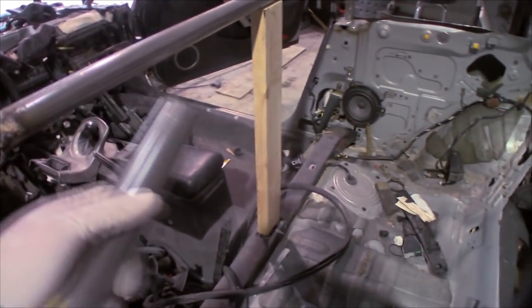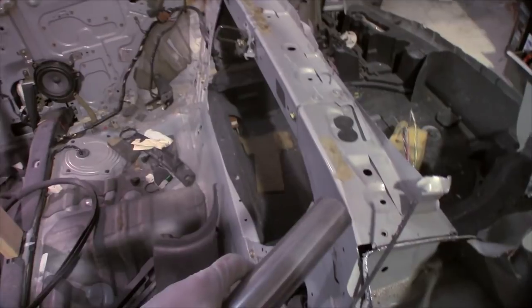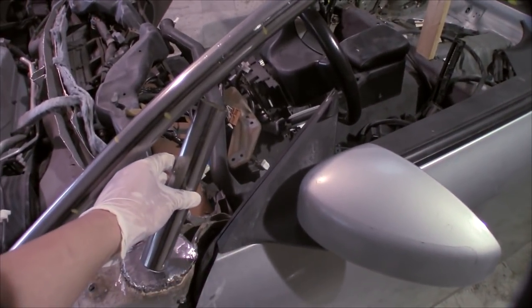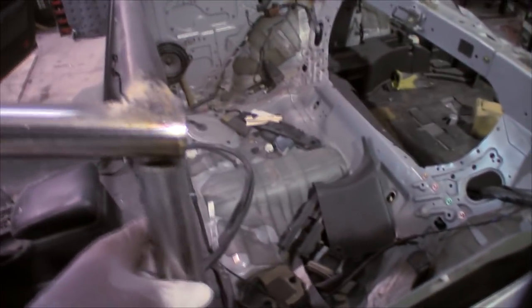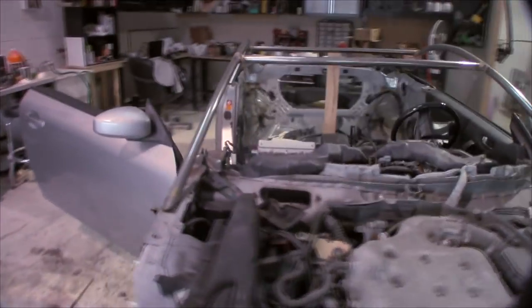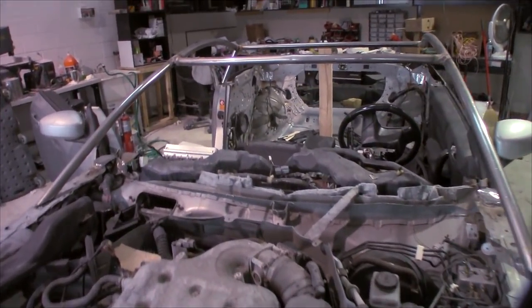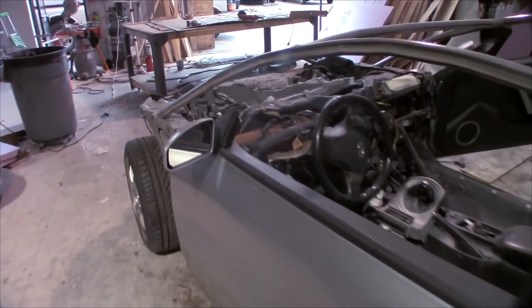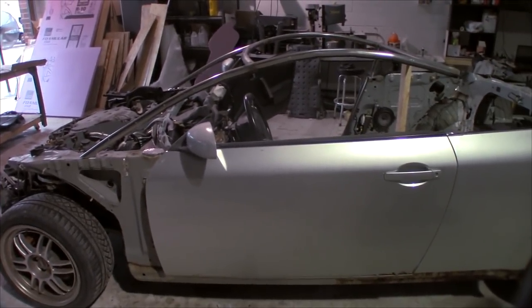After I put in the four posts I'm going to think about how to reinforce the roll cage — probably bringing crossbars from the rear cross beam back to the support and welding that in. It's gonna look much more complete with the four posts in, and when everything's welded into place it won't look like such a Frankenstein car with the roof chopped off. We got the roll cage almost in, just have to create the four posts, reinforce it onto the existing chassis, then move forward with making the body. Thanks for watching.